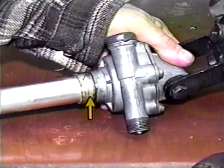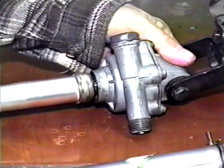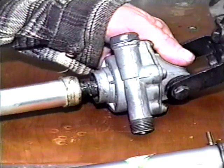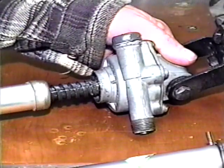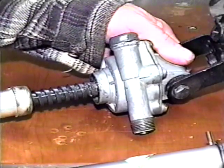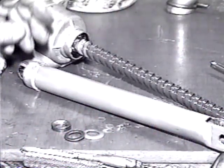The nuts are located in the bottom of the shafts that lift the deck. Fill the shafts with penetrating oil and allow them to soak for a day or so. Then, with a little gentle tapping at the base and some twisting of the shaft, you should be able to free up the screws. Once you have them freed up, they can be disassembled as described in Volume 2.